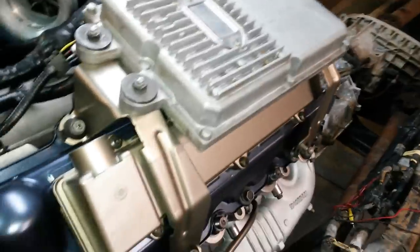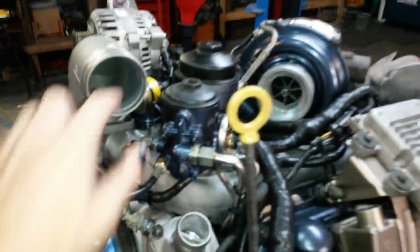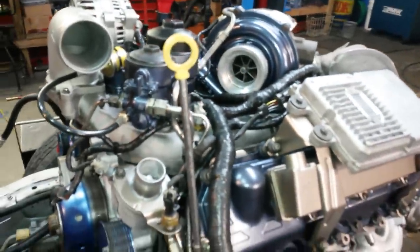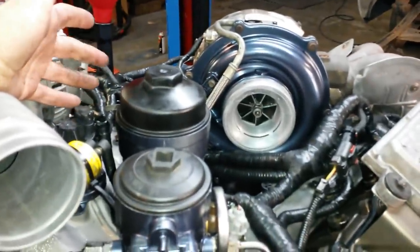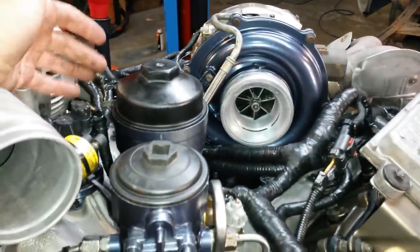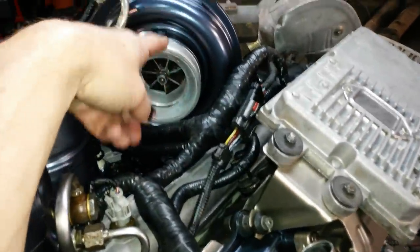That's where all your fumes or your blow-by comes up out of the crankcase, back through that hole, back into the turbo, all the way through your charge air intake system and into your intake elbow there. So the whole system gets all full of oil. The little silicone CAC boots start to get gummed up. They stop sticking. It's just a big mess, and it makes the turbo a lot harder to clean.